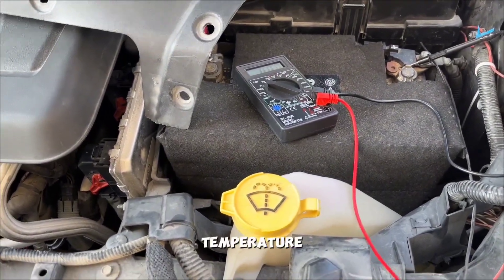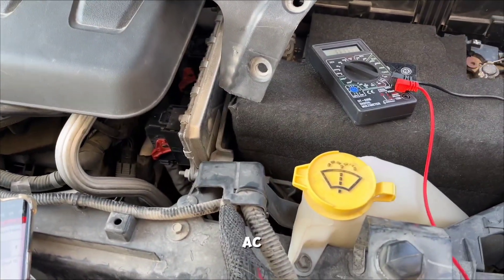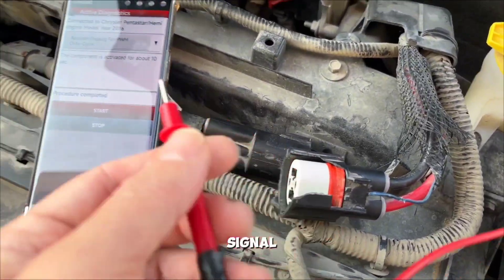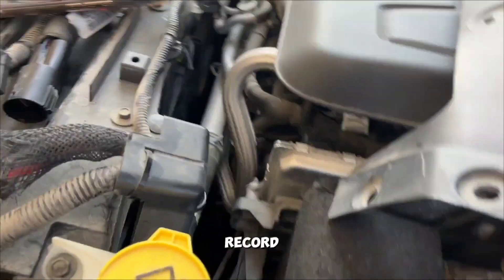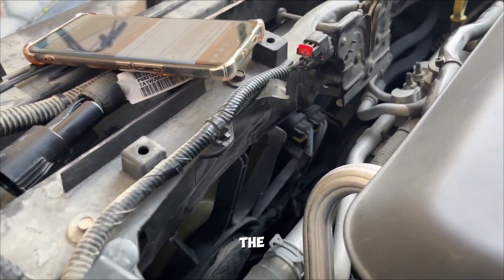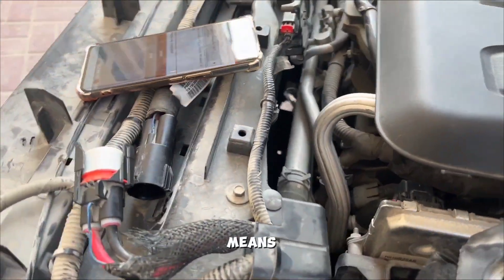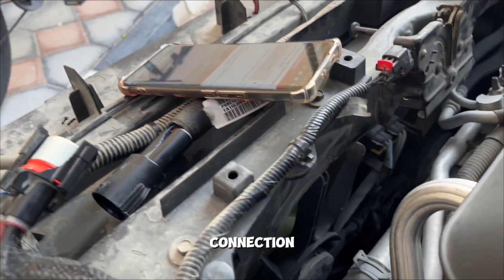It's going to be high temperature if the car is hot, or if you turn on the AC — all those parameters should trigger the signal to turn the fans on. For the record, my car has two fans; it's the HD cooling system.